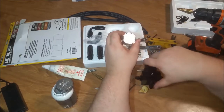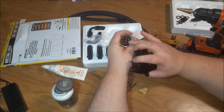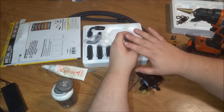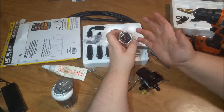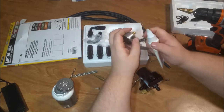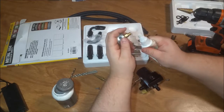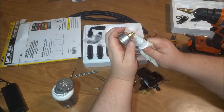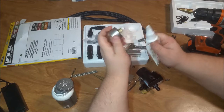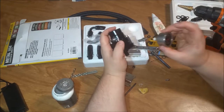Another thing, if you're doing what I'm fixing to do, this gauge is going to be something you use very loosely, which maybe most people probably do. Like, if it reads 0 psi where it should be 50, then you might have an issue, but I'm not going to set my truck with this gauge. What I mean is you can't get an accurate enough reading on this gauge in the place that it's at. This is more along the lines of telling you that you have an issue, but I wouldn't use this to set your pressure.